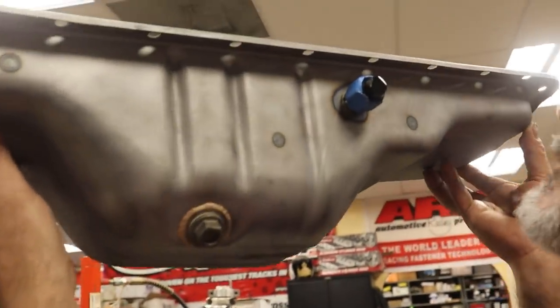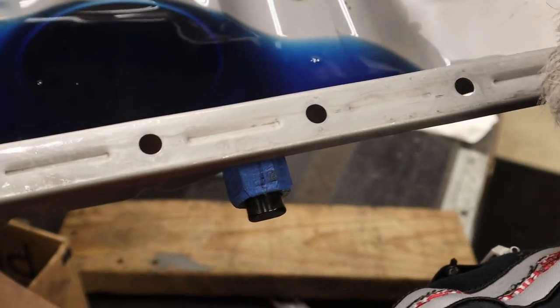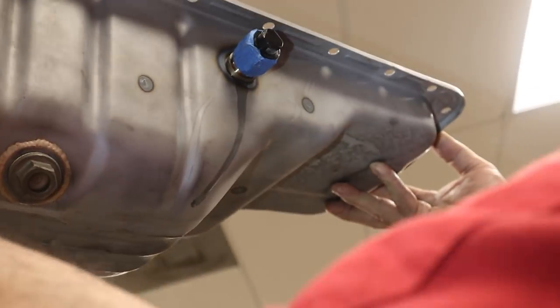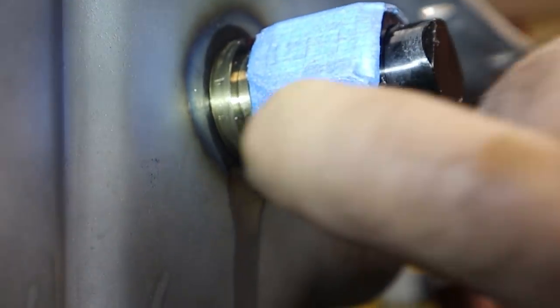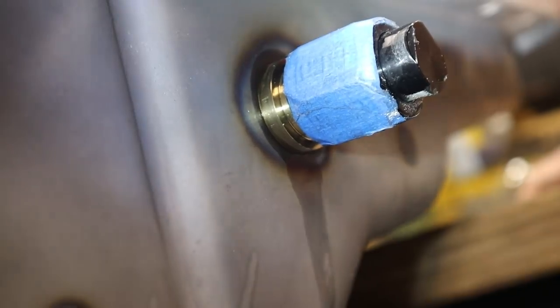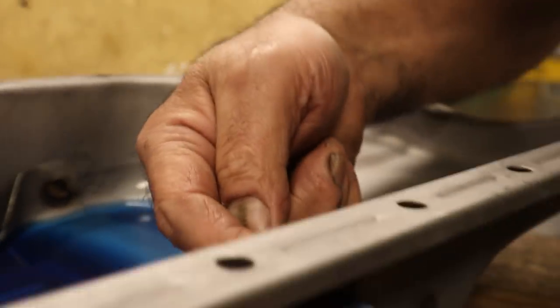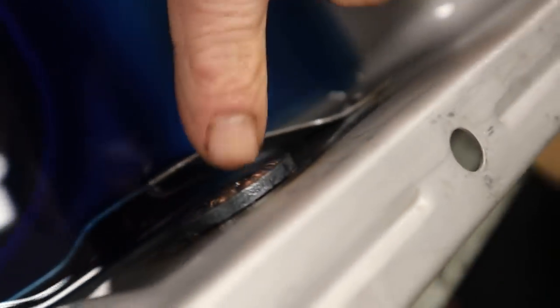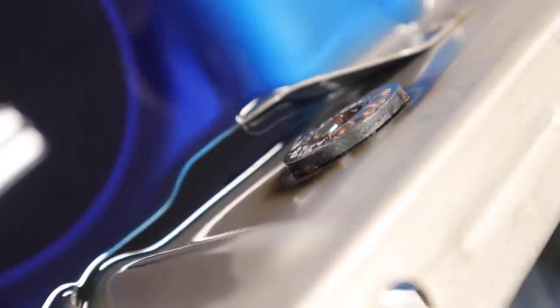Now we're going to check the turbo drain. I'm going to come up to it. I'm now over the drain hole. How does it look? Oh! There's what we're talking about. See it? It's coming from behind it. Damn. So you know what that means? That the washer itself is leaking. It's not our weld. Our weld is tight. It's the factory, however they press it or whatever they do on the motor, it would have leaked. So wow, leak testing.